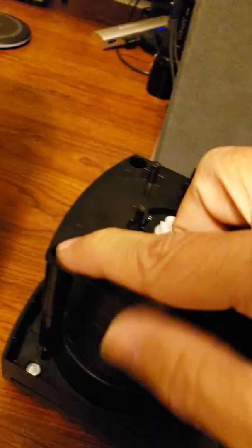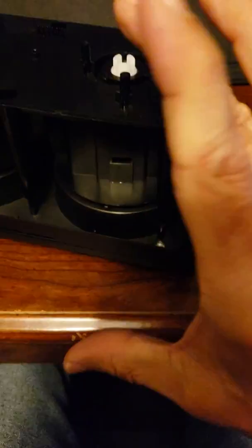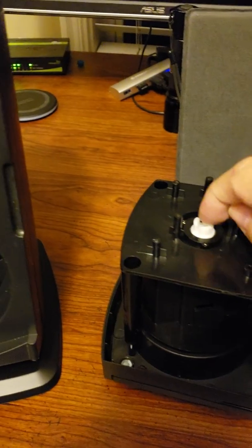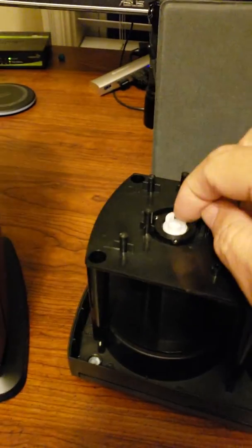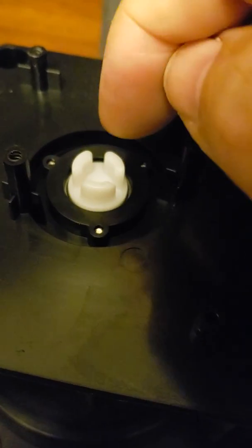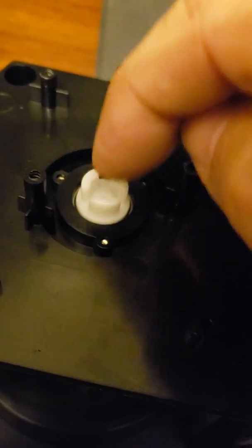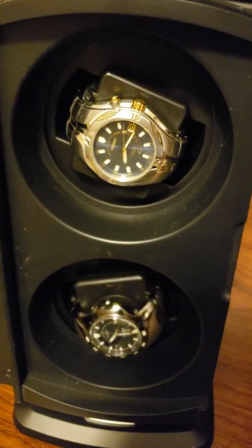And I also had to take the screws out from these pieces to separate this into 2. That allows you to get that barrel out, because there's 3 screws that hold this piece to the barrel. Actually, it holds it to this bracket. And then you take that same little grinder wheel and you remove 2 of these. So you're left with 1. And so when that motor piece with only 1 of those left turns, it connects on one side, it turns it around, but then gravity takes over and it'll allow it to flop down, doing that motion again.